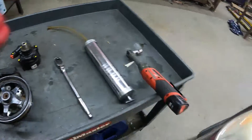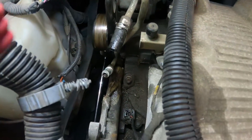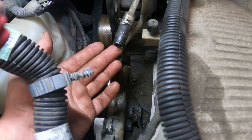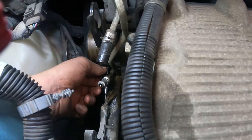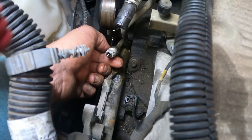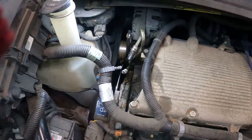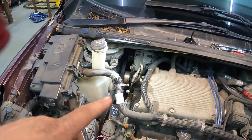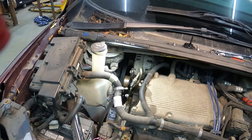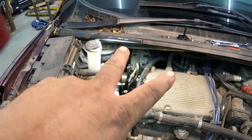I bought just the pump, so I'm going to transfer the tank over. You can buy them with or without a tank — that's up to you. Transfer the pulley and the tank over and then mount it right back into place. The only thing you might have to fight with a little is this hose, and take your time on this fitting — make sure you don't cross-thread it putting it back together. That's it, it's that simple. Please like and subscribe, it helps the channel out a lot, and we'll catch you in the next one — peace out.